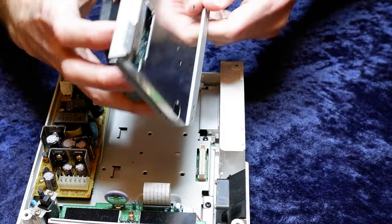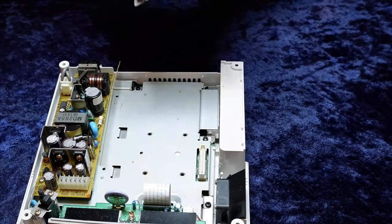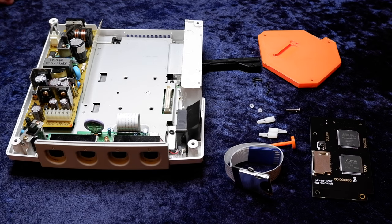Make sure you lift from the base of the GD-ROM rather than the top, as they are two separate pieces. If you're using the 3D printed tray kit, which I highly recommend, here's what you'll typically get: a black frame piece for mounting the GDEMU into the case, some mounting feet which typically come with the GDEMU that you won't need, an SD card extender and ribbon to access the SD card from the top side of the Dreamcast, one super long screw and various small screws, and an orange tray with a long push button that lets you access the SD card directly from the top of the Dreamcast by opening the lid. The GDEMU is seen in the bottom corner.